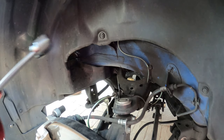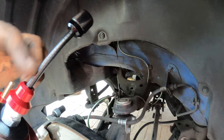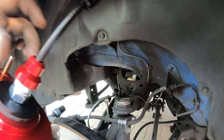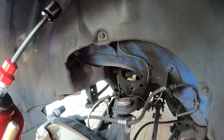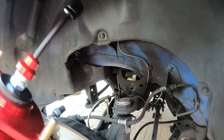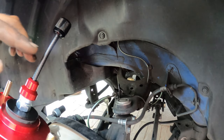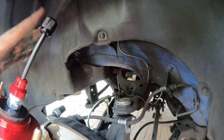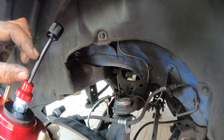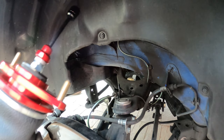All right, so now the rear bag has to go in. Before that, make sure you install your little dongle here on top of the other little adjuster down here at the bottom so you can adjust your dampening inside the car. Yeah, it's kind of stupid in how they did this. I don't know why they just didn't make it a little bit taller and just let you adjust it, but this is how they want it. They want you to cut it shorter. I might do that. I'm not 100% sure yet. I'm not at that point, but they want you to cut it a lot shorter. I don't know yet what I'm gonna be doing when I get to that point, but this is how it's gonna look before you install it.